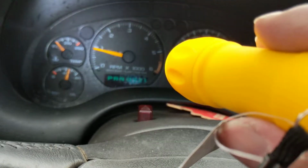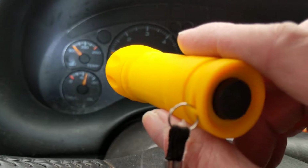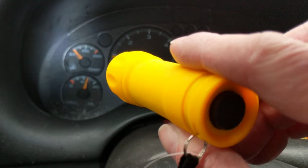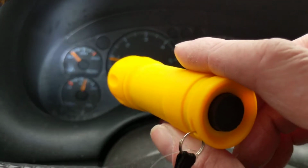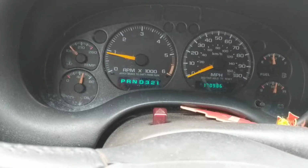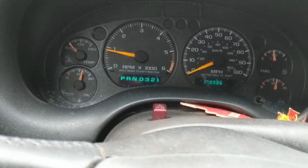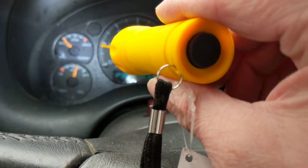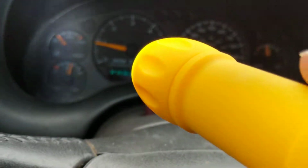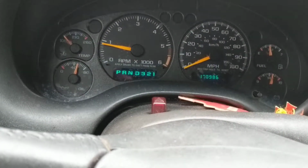This is a Chevy. Therefore, as you see, the RPM will go down, and it should go down to about 600. The temperature will steadily go up, and it should be around midpoint, which is around 200 to 210. Like I said yesterday, on a very warm day, if you have the compressor on, or if you have the air conditioning running at idle, you'll be around 210, 220, which is normal. Anything over in this area, too close to 230, 240, you should be concerned.